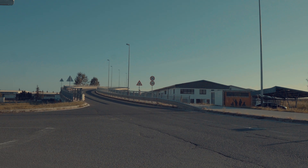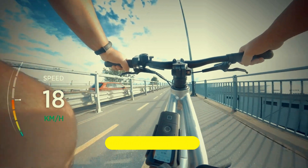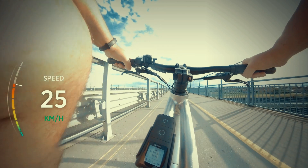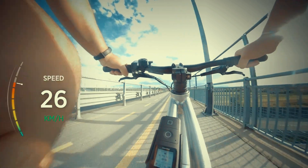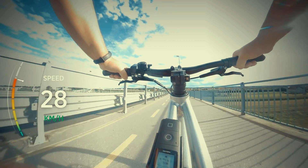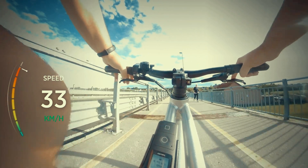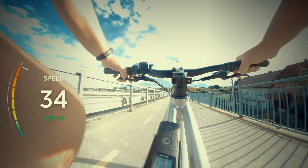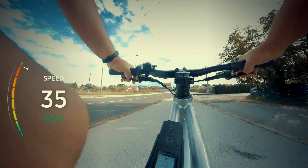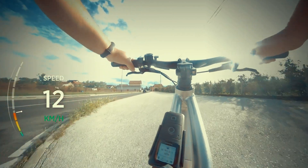Let's see how the uphill goes. I'm going 18 km/h — just remember I have a hub motor, 16 Nm, this is not a mid motor — and I'm not really sweating or anything. Going downhill it cuts power at 27 km/h, but I can still pedal faster. The brakes — I have 100% confidence in these brakes since they are Shimano MT200. At 36 km/h, brake test: no problem at all, the brakes are beautiful.